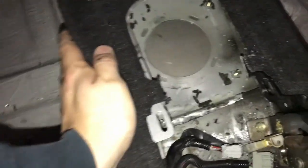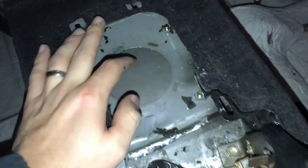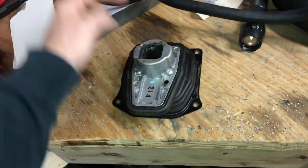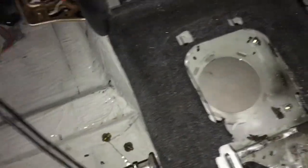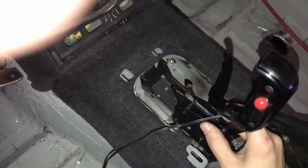Here's where the factory shifter came up through, and you can tell I already have a piece of metal plate here. What I actually did was I knew where the factory was and I still have my OEM transmission over there, which is for sale by the way. So I took the boot part off and I overlaid that onto the piece of sheet metal, then just cut around it and added these four through holes, and that gave me the pattern you see right here. I was able to bolt that right up in as if it was the other side of the factory, and now I can take my shifter and center it up here where I want it.